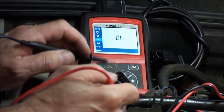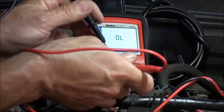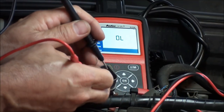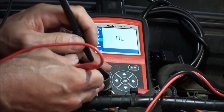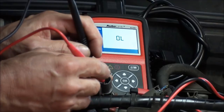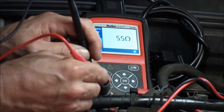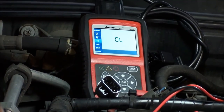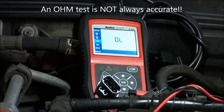Back at bank one — gently putting pressure on the pins. We're getting 5.5 ohms. The other one was 5.8, so they're both pretty much in spec for being hot. That proves a point: the ohm test alone won't tell us which sensor is bad.